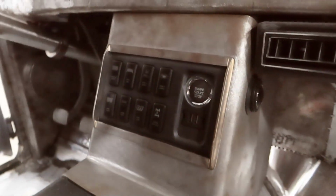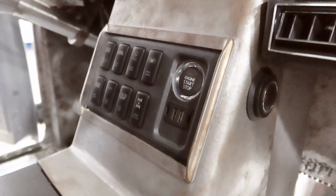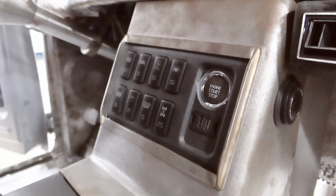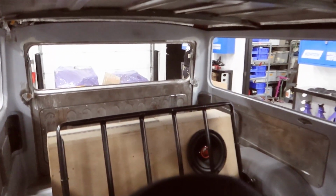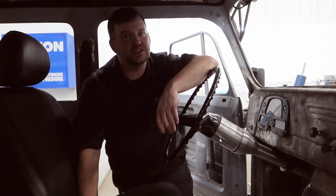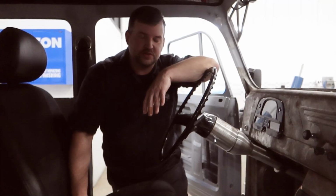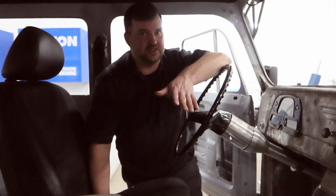Yep. And then in this case, we incorporated a whole lot of new stuff into that electrical system. Even that in itself, between the light bars and all the fog lights, and just a lot more loads, stereo. For that to still be okay on an original Lexus electrical system, to upgrade it but still have it, because it controls the alternator even. So there were a lot of things. You had to treat it like you were doing it to a new Lexus, because it still is, and it still thinks it is.